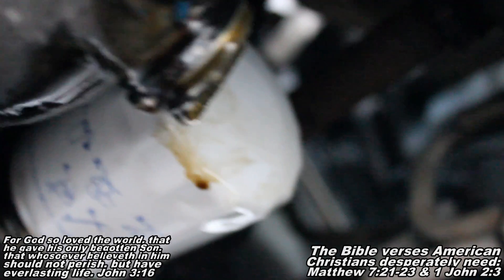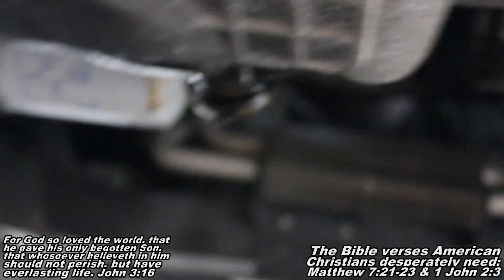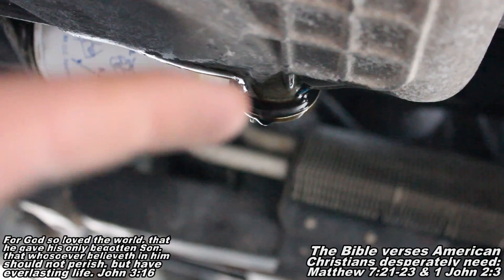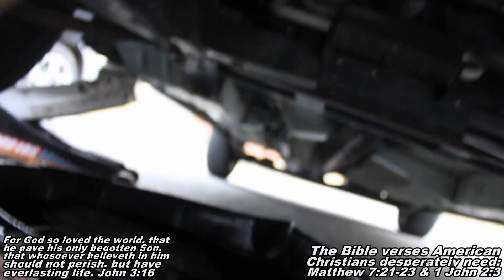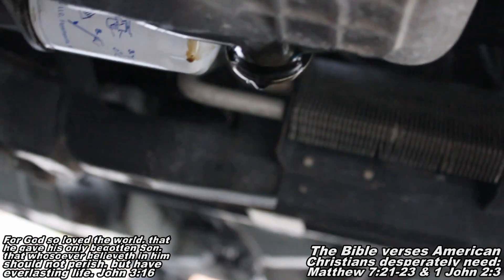You can see it's like a wing nut and your oil filter is right beside it. If you have this wing nut style and not a bolt — normally there would be a bolt sitting here — basically you'll take a pair of pliers and loosen up. Once you loosen up all the way and the oil starts pouring out, you'll notice the plug doesn't come all the way out.